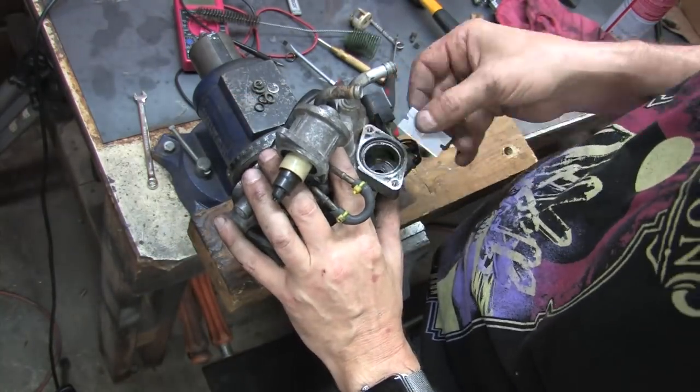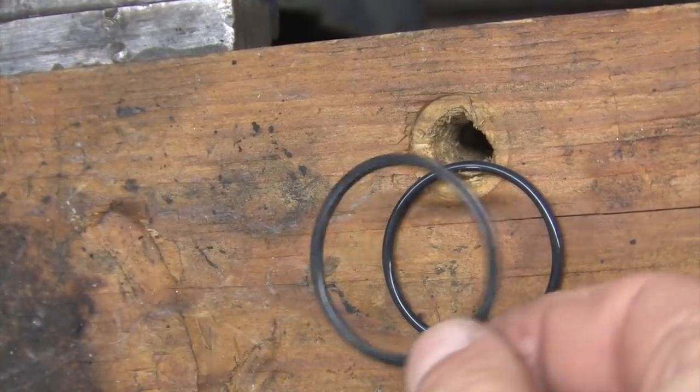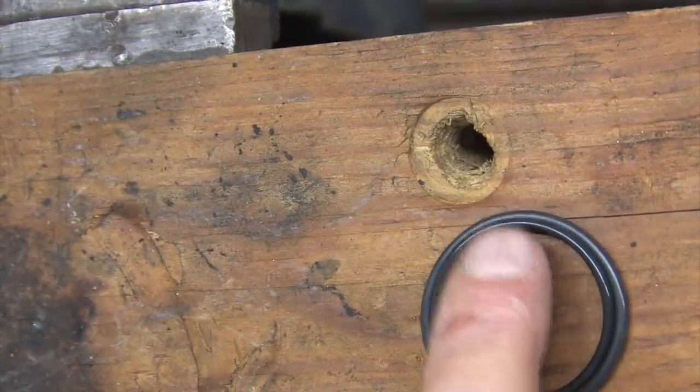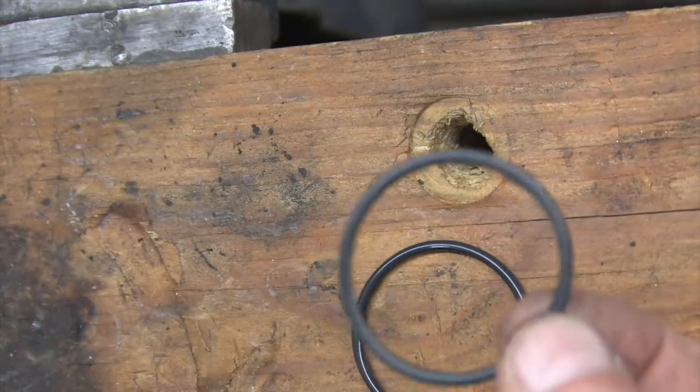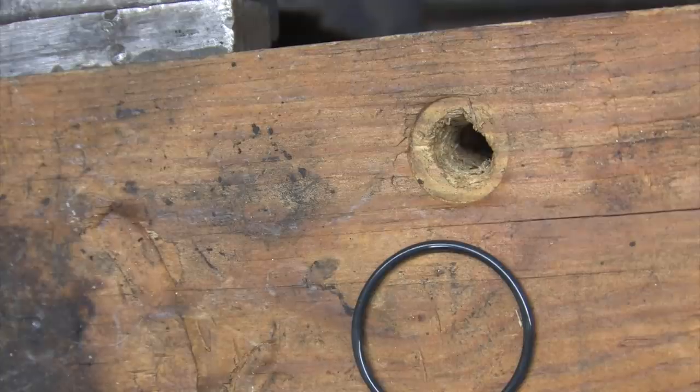I just want to be sure it would clamp all the way back down on the flange to squish its new seal as much as possible to help the boost stay in. I don't know why, but I found it amusing that the O-ring grew while clamped tightly in that groove. But I thought I'd show you that. It's just another way an O-ring can fail.